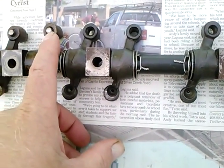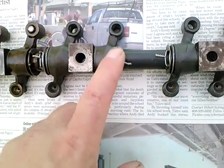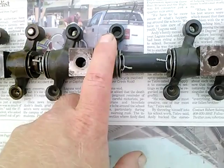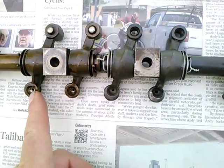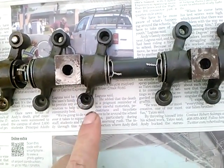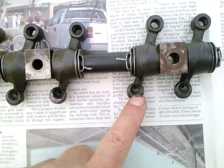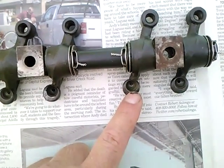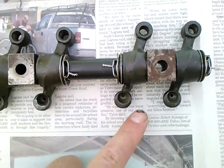So here where the adjusters contact the valves, for each action here there's going to be a greater action there as compared to the standard ratio. And again, these have VW markings — they just have the pushrod indentation offset a little bit on what looks like the same forged arm.